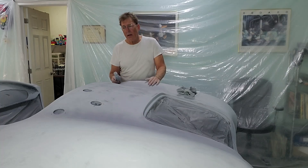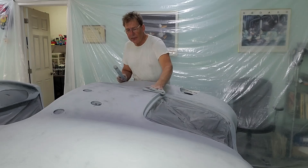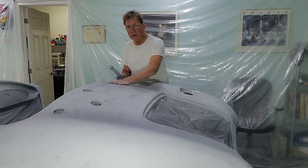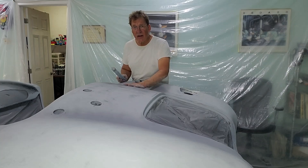Now I'm going over the car with a cloth and some cleaner, cleaning the panels, and then running my hand over the surface. The reason I'm taking my hand over it is because you can't always see if there's a dip or an air pocket or a bubble in the body, but you can feel it.